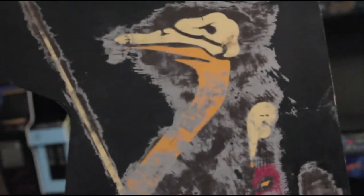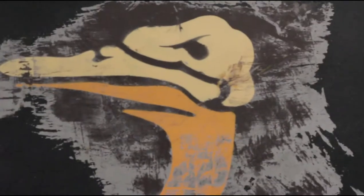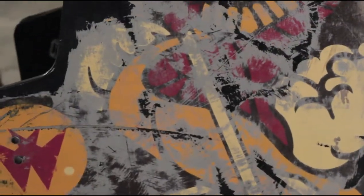It ends up eating away at the paint underneath. I'm trying to salvage what's there — might end up getting a stencil and just redoing the whole thing, but I'm trying to save myself 85 bucks. There's a big gouge here, might do some bondo work. So yeah — Citrus Strip, 15 minutes turns out fine. Leave it on the gray stuff even two seconds and you get this smeary crap. 15 minutes tops. I don't think we're doing any artwork today — I've got too much other work to do.